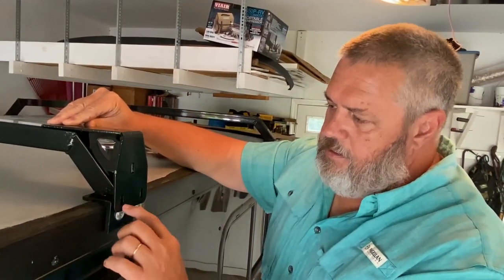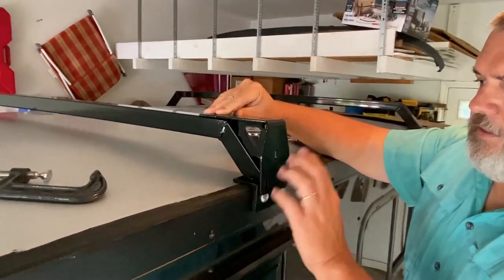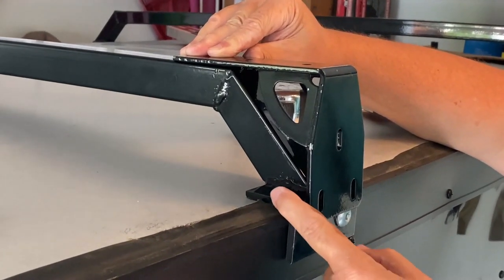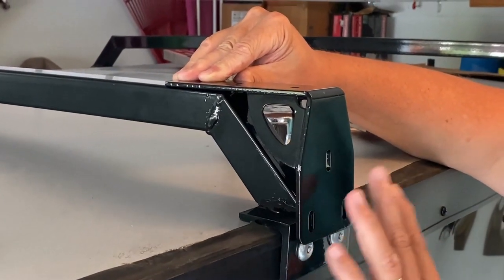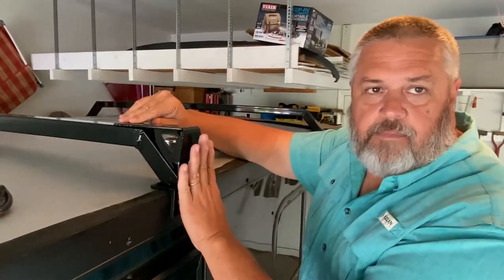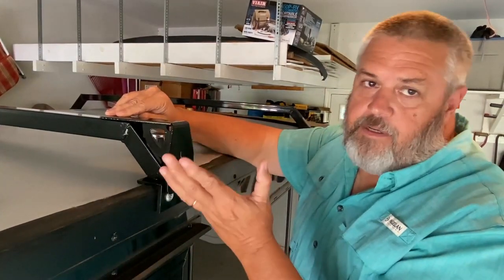And not only that, the bolt holes that we're supposed to use to mount the awning to this bracket are now being covered up by the factory bracket. This doesn't work either. There's only one way to secure it, and then you can't bolt the ARB awning to it. We have to come up with another solution.